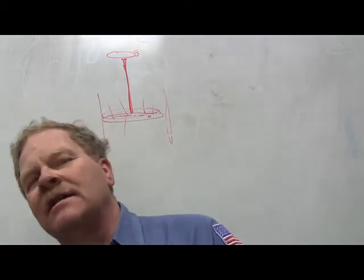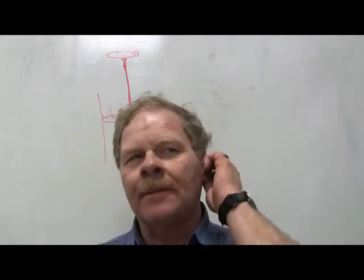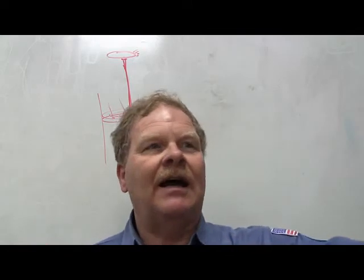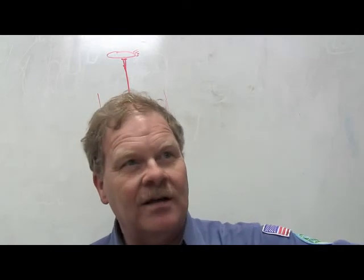What is the ride height sensor in this scenario? What do we call this? It's a feedback loop, right? Mm-hmm. Basically, the module is watching the ride height. It sees the ride height go too low, which basically is just a switch. It's a kind of a digital switch in most cases.